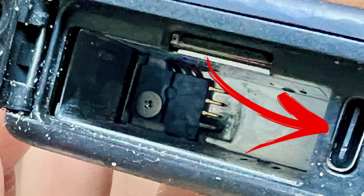You can see if your GoPro still works by letting it dry out completely, then plug it straight into the power adapter and see if it turns on. The camera seems completely dead, but I sent the first one back and they replaced it. Then I bought a GoPro 11 because this happened again — they have a really good deal right now, about $350 that includes a year subscription and two camera replacements. In the meantime, I plugged in the GoPro and it worked just by going straight to the power cord. So I looked up some videos on how to get rid of battery corrosion and was able to get my GoPro 9 working again. If your GoPro is already dead and you're thinking about sending it back or buying a new one, you've got nothing to lose by trying to fix it like this.